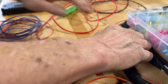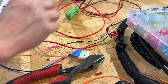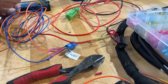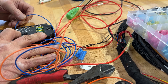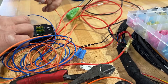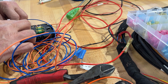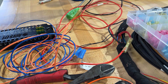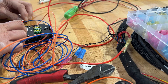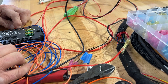Technically at this point you can tape this back up. What you have here: you have your red 12-volt battery connection; the blue wire will be your MRD, which will go right here on your PDM into the MRD slot; the orange wire — the one for your pump relay — now goes into your pump because this is your trigger wire for the pump. Your main wire, this is your big hot wire that goes to the battery, and this one goes into the main slot. Then your ground wire over here.